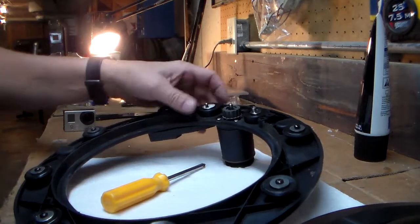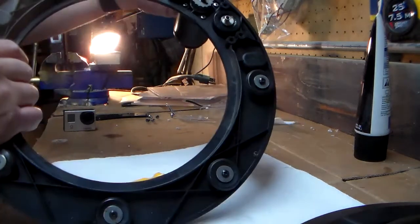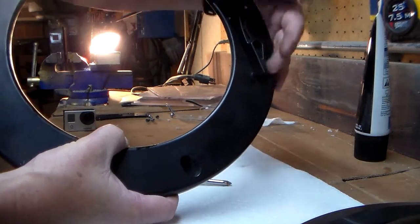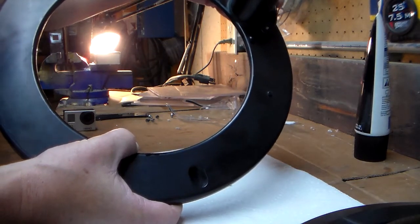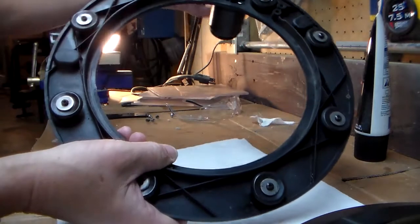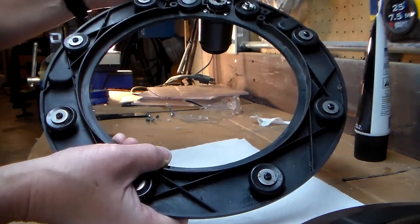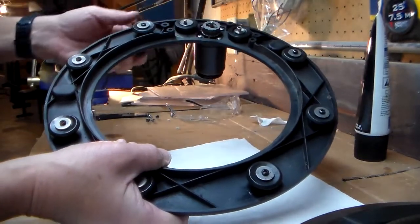It goes around this cogged wheel here. If you haven't seen the inside of one of these, this is the clutch that activates or engages the autopilot once you've turned it on. So that locks it on so that now when this motor turns, it moves the wheel. The way it does that is through this kind of concentric circled gear thing here, and it pulls tight, it rubs tight on the belt, tightening the belt around the outer plate. So that's how that works.